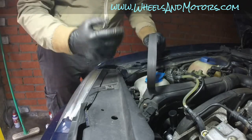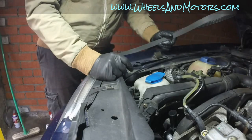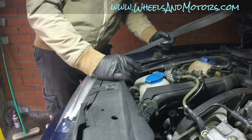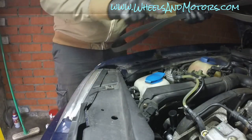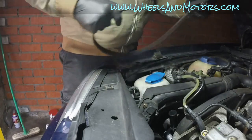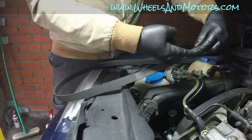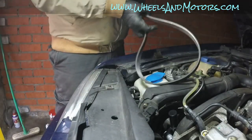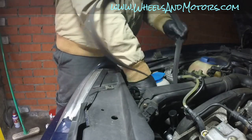Unfortunately, I can't show you in this video the position of the belt around all pulleys, but there is a link below this video which will lead to a description of what we have done today, images, also a diagram of the position of the tensioner belt. So remember, if you're refitting, we're gonna fit it the same way. These letters were going away from the engine, so we're gonna fit it the same way, so it spins the same direction. It's a good condition belt, so I'm not gonna bother to fit a new one.